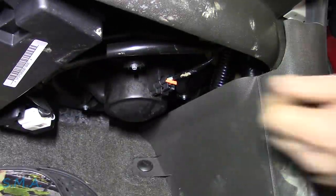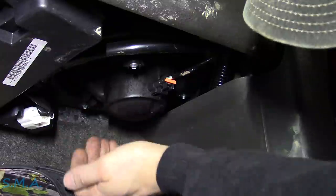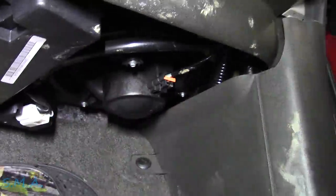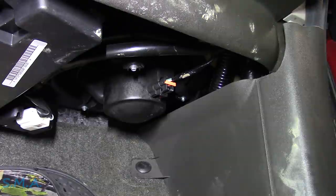What do we have here? We've got the key on, we've got it cranked up on high. Let's give it the old Fonz first — hey. Works better in the movies, I guess. Let me get a good ground here. I like to go off the door latches; they are usually shiny and grounded well.